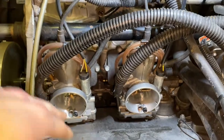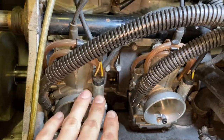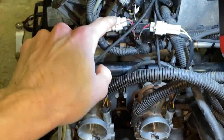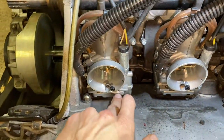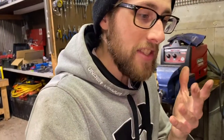We've got two main feed lines that go straight to the carburetors. I'm assuming this here is the power valve circuit, because I don't think there's any other circuits that would need power. The throttle position sensor is up here - you pull your throttle on the thumb, the cable comes down to a three-way split: two go to the carburetors and one goes to a sensor. When people talk about disabling power valves, I believe they leave these connected, because if you just unplug them the ECU will know and there may be timing issues.